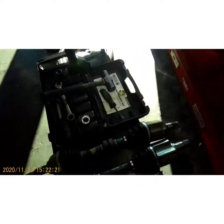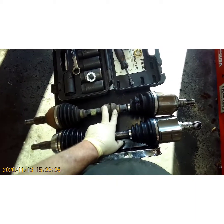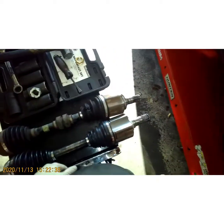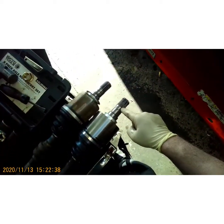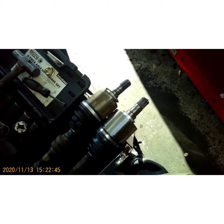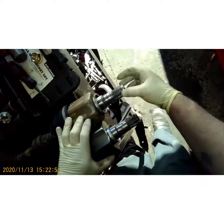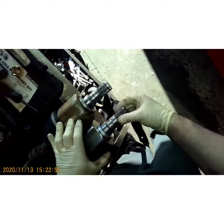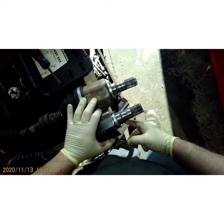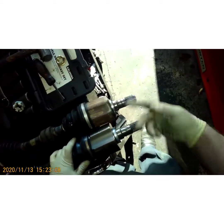Alright YouTube, I'm back — I've got my axle and I've already compared them side by side. Now some of these aftermarket axles won't come with that bushing — it's just a noise dampener that absorbs vibration, but I've never had any problems putting an axle in without it. Also notice these little cutouts — they're a little different but that's no big deal. The main thing you want to look for is the same length, the same spline design on both ends and the same width. This part right here is what goes into the axle seal to seal it from leaking trans fluid, and these little grooves just whisk the fluid away from the seal.